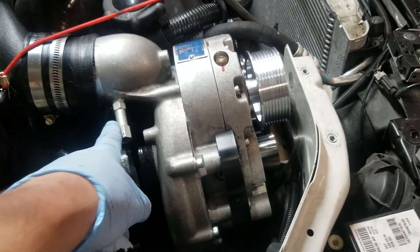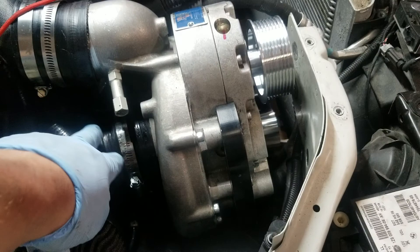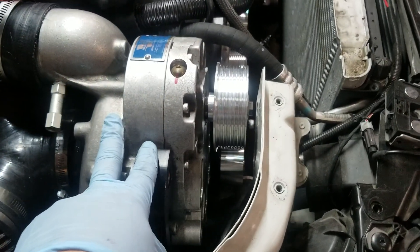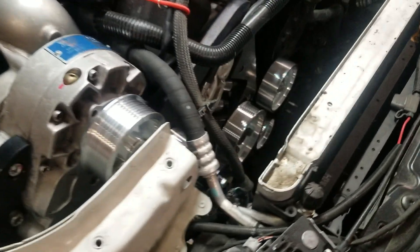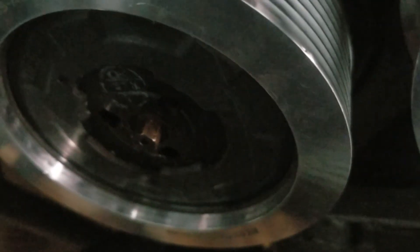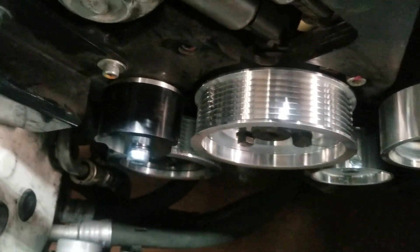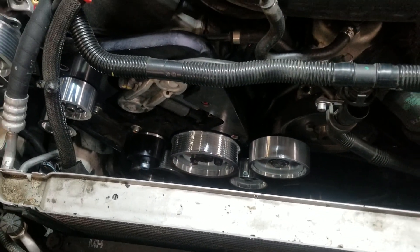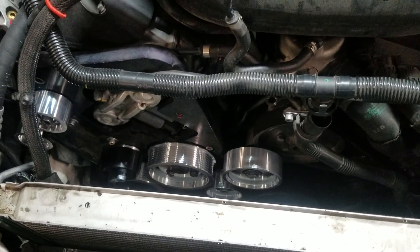This one is actually running methanol injection as well, so the clamps have to get loosened. The supercharger has to come out. All the new pulleys have to obviously be removed, and then the AC clutch pulley has to be fully disassembled, and the upgraded eight-rib belt has to be modified in order for this supercharger belt to work.